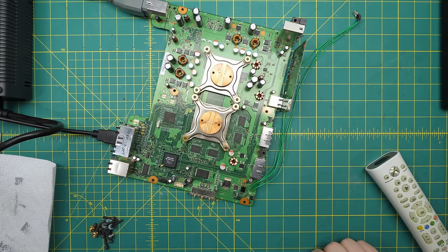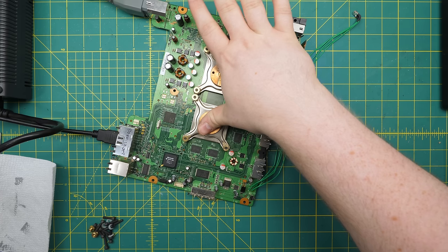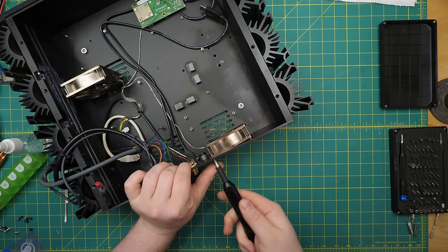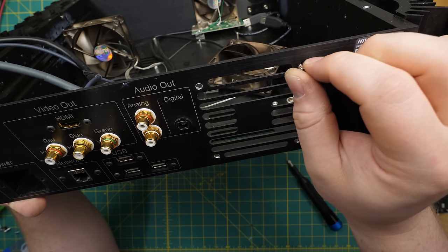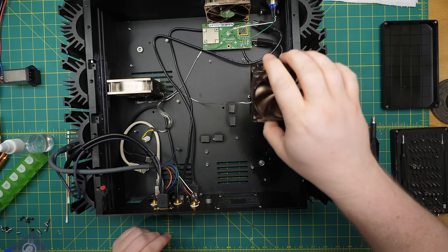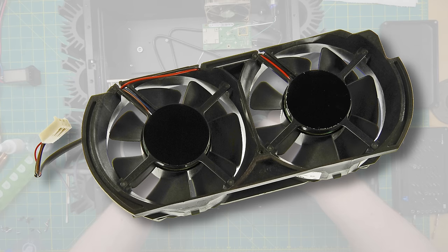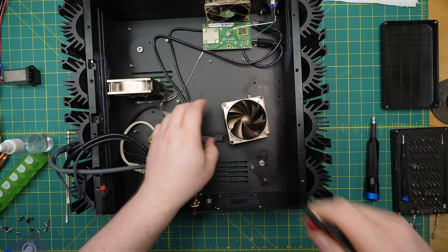At this point I decided to give the thing a real quick test. I didn't want to put in hours of additional labor just to find out I'd killed the board, so I plugged it into a supply and did a very brief power-on test. I got a picture on the screen, slugs got hot — that told me they were making good contact without damaging anything, so yeah, everything's still on track. I did have a couple more things to do before reinstalling the board. First, I removed the dead fan from the back, and in the process I found out that Niveus had the wrong size holes stamped for the fan screws — they're a bit undersized, so they had to just force the screws in, cutting threads into the aluminum and flaking off the anodizing. A few commenters were curious if the board expects a tachometer signal — the answer is no. This board actually has no TAC input at all. There's a single three-pin header for the fans that just has two five-volt pins and a ground. Niveus just ignored the third pin and cut that wire off — all three fans are just running off a single five-volt rail.